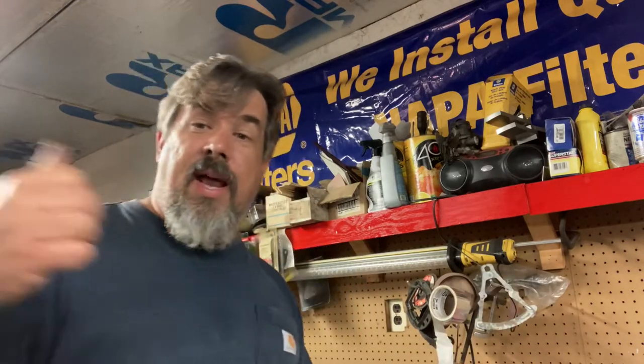I should probably take you to the other side of the shop and show you a pickup truck bed I treated. It was basically no prep — I had a little left in the can, didn't want to throw it away, there were some rusty spots in the bed of my 66 Ford pickup, I took a wire brush, knocked the loose stuff off, blew it off with an air nozzle, and used the rest of the product brushed on the rusty spots on the floor of the bed. That was about eight years ago, and that truck sat outside a lot — no prep, no grinding, no Rust Away, nothing. The rust has not bled through the silver. It's still silver.